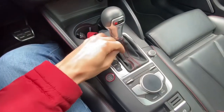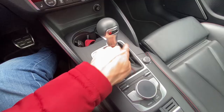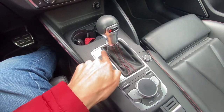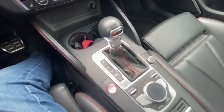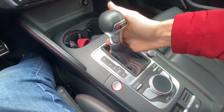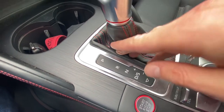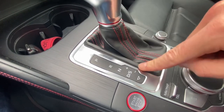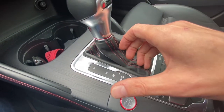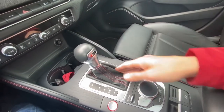This leather trim is held with four latches. In my experience, the front left one is the easiest to remove — if you put your finger deep inside over here, you can actually lift it a little bit. When it moves, you can try to move it to the side as well, and once this side pops you can move it to the side and bring it upwards to see what's underneath.